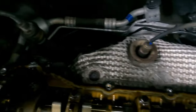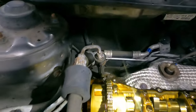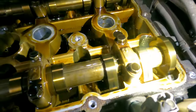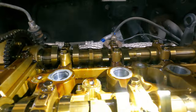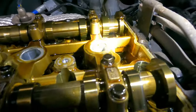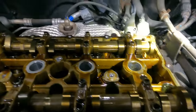So what you're going to see here is the whole back of this cylinder head. You can see all the oil that has been seeping past this valve cover gasket. Aside from that, this engine is actually pretty clean. For 200,000 miles, there's very, very minimal wear to the lobes of these cams. You can see this one actually has got a little bit of wear, but again that's 200,000 miles - this thing held up pretty well. You can see all of our valve springs, all of our buckets, everything in here looks pretty good. This chain is nice and tight. So I'm happy with what we see here.